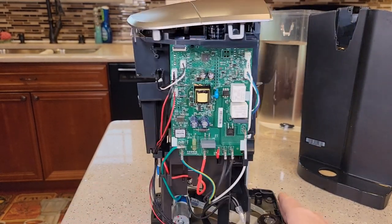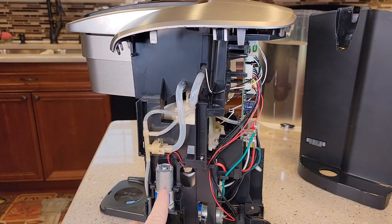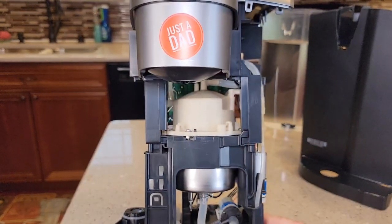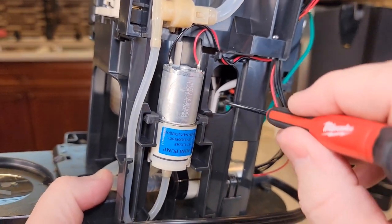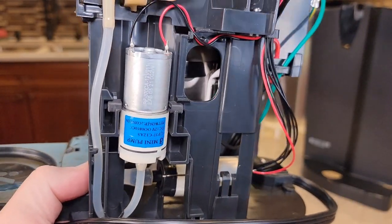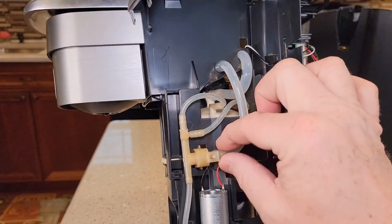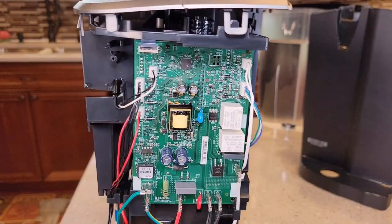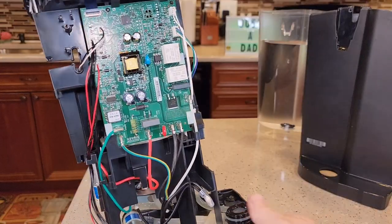This machine seems very well built — it's kind of an older-school one. Here you've got your water pump down at the bottom. Here's the air pump. The big heating tank is right there smack dab in the middle — again, that gets really hot, be careful. I do think I see a thermostat; it's not resettable or anything. It looks like it's right up against the water tank underneath this clamp, so it probably just opens up and you'd have to replace it. I haven't heard of any problems with the thermostat opening up. Here's the tubing — I don't see zip ties on it, so you could have had a tube come loose. Here's the control board; doesn't look like there's a fuse or anything you can reset on it. Pretty simple machine.